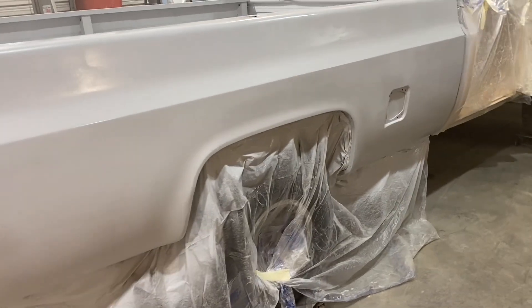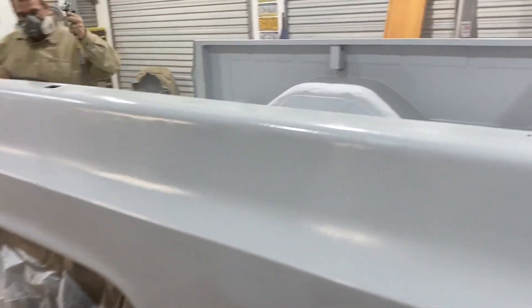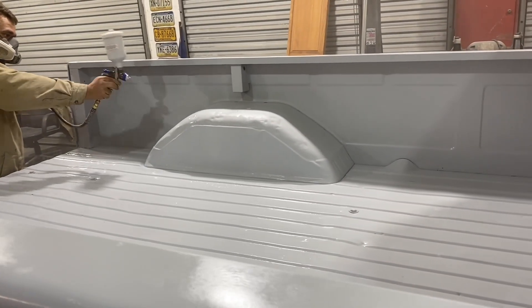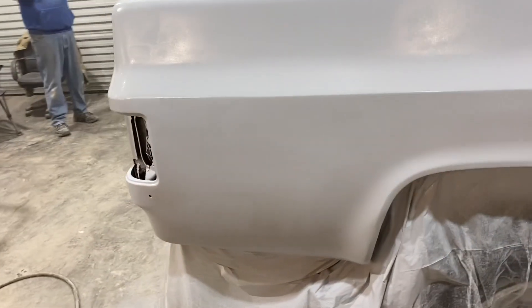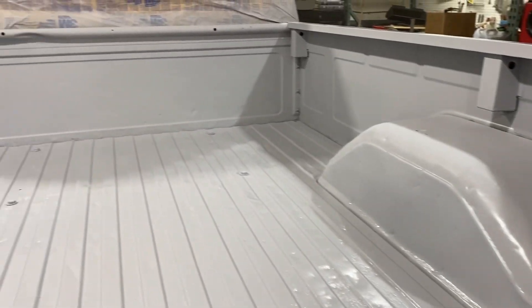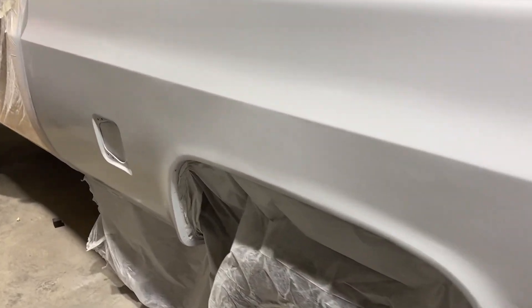Make it ready to paint for Monday. The film worked out pretty well — I haven't really looked to see if I got any overspray on the cab, but I think we covered it pretty well. I did notice the inside of those fender wells was pretty light, so I needled it down and got a little more paint in there just to be sure it was covered. KJ is going to give us a quick walk around of the finished product. Had to do a lot of work on that corner right there — it was all beat in, so I got up in there, got in behind it, pushed it out, and then worked it. Bed interior looks pretty good. We have to put new seam sealer in all the seams — Chevy bolts their beds together so you're going to have to seam seal it. Brayden was able to get all the old seam sealer out, so now that we've got it in primer we can do some new seam sealer.